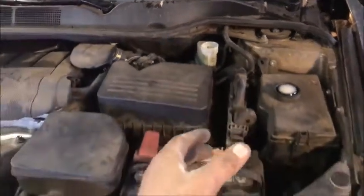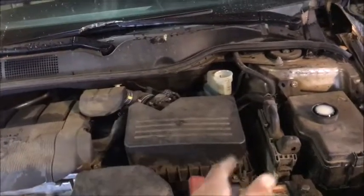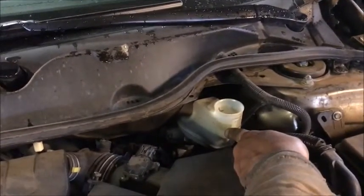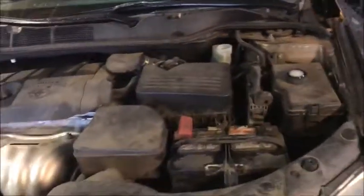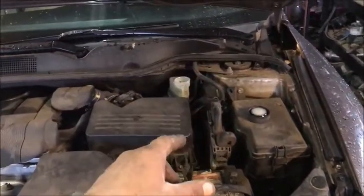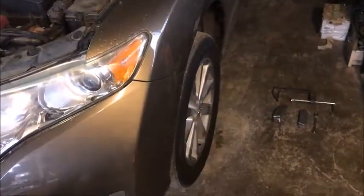Very simple process. One person can do this in about 20 minutes, both sides. Don't top off the fluid yet — you'll see that level is going to raise. Since we're changing the brakes, we're not going to top off the fluid because we're going to force some of that fluid back in there. So let's go ahead and get this tire off.